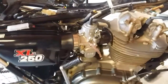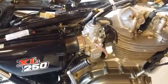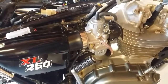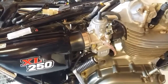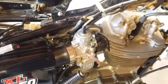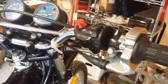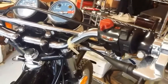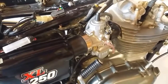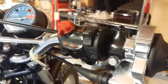On the other side of the conversion, this is the header pipe and the reverse cone silencer — all stainless steel — tuned for the Mikuni carburetor that replaces the Keihin. It's a larger carb and has been meticulously jetted specifically for the XL250 by Dave Reinhardt. It comes complete with the correct size throttle cable and throttle assembly, still allowing you to use your original switchgear — you just move it over. This carb, along with the tuned header setup, really makes this bike run so much better and come alive.